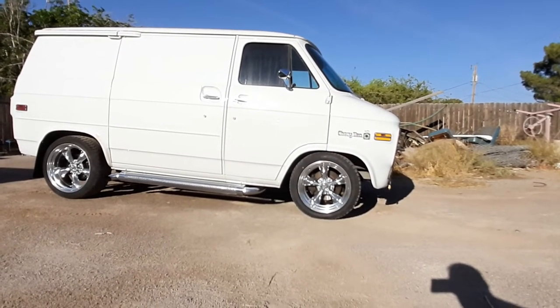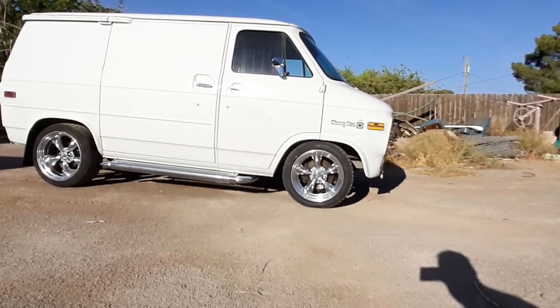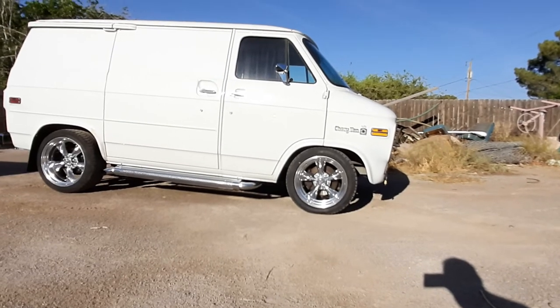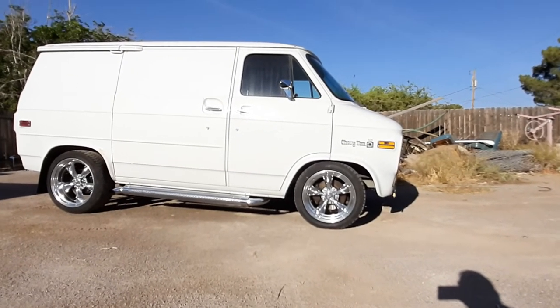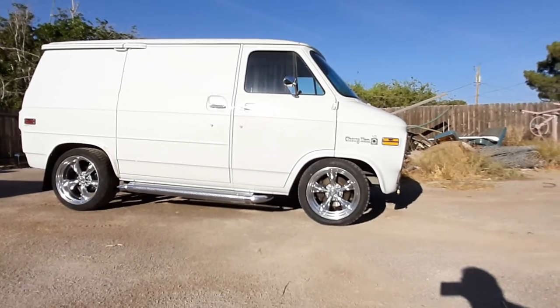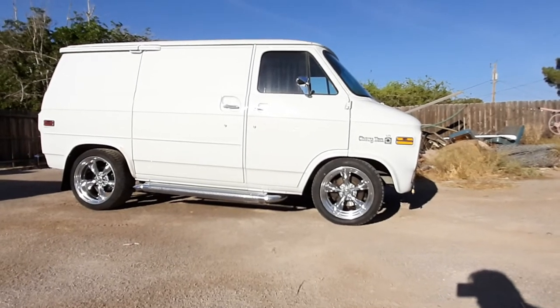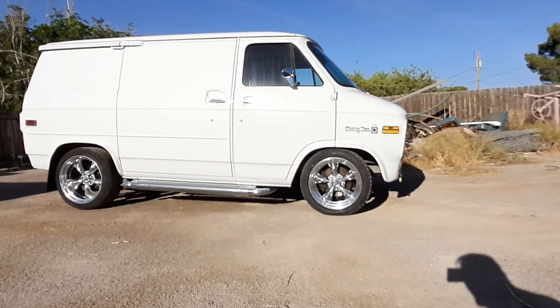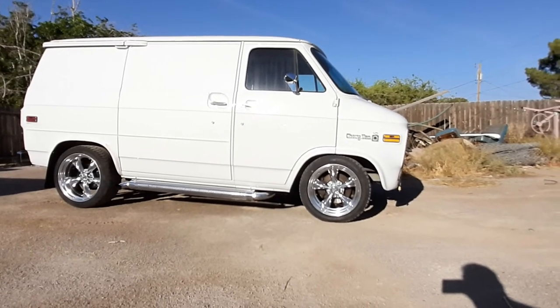I know that they make these twist-on little block deals that you stick between the coils and you twist them and it'll raise it, but oh, those are so tacky. I'd rather just leave it like this than do something like that. Or, like I said, I have the stock height springs. I can cut a little bit out of them at a time until I get it perfect.